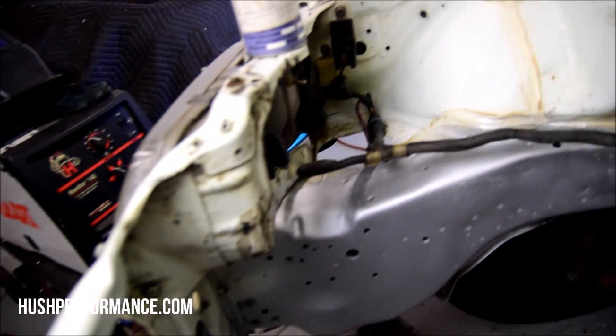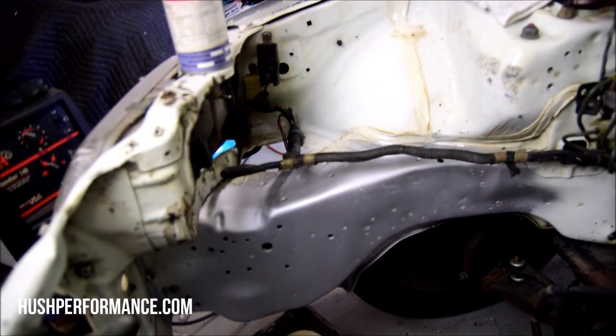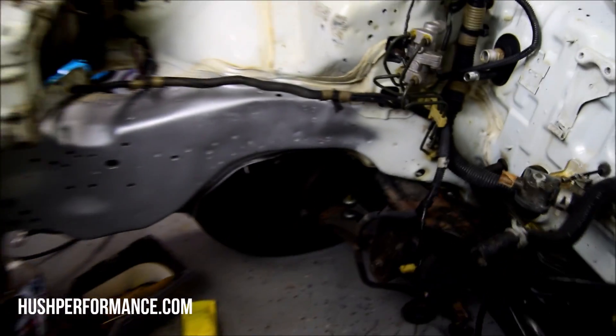The zinc covers really well — that was just one coat; I'm going to go over it at least one more time. I didn't really mask anything off, because I have color-matched paint mixed up by Sherwin-Williams: single-stage frost white. A lot of automotive paint shops can mix the color paint you want to match the car directly in an aerosol can. We had the can made for that white car with all the rust we showed you — and of course we found out about the zinc stuff after that car was built. The technique we use here we call the 'Dustin Hoffman' — one of my buddies was a painter who talked about dusting paint, and I named it after him. While the zinc's drying, we'll go ahead and work on the weld-in part that goes in the rear crossmember.